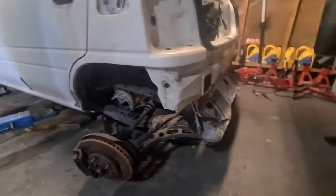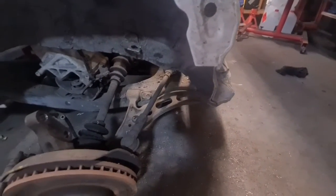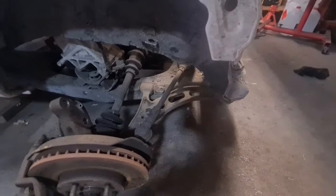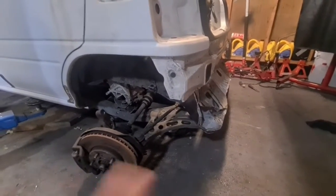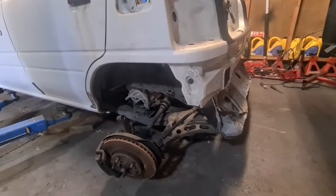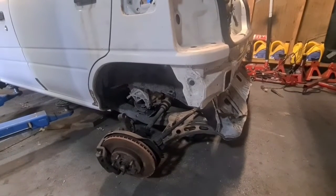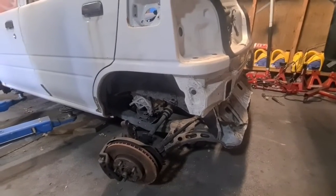And from there, the steering rack still. But if that's solid mounted, I don't know that the steering rack's going to be an issue. I might just be able to leave it as it is. We'll test that theory out anyway, otherwise I'll go back to my original plan, which was to take the rack part itself out, leave the ends on, and just weld a piece of tube in there, or weld it to the subframe somehow. So I've still got some adjustment on either end, so I can do toe in, toe out, but it just won't move, because we don't want rear steering when we're doing wheelies, do we? No, we don't. Okay, bye.